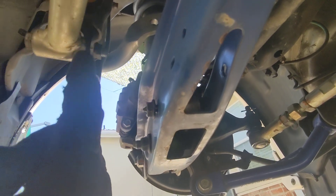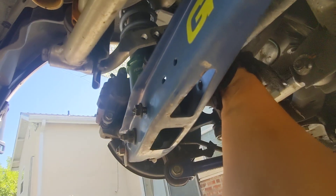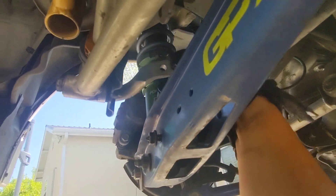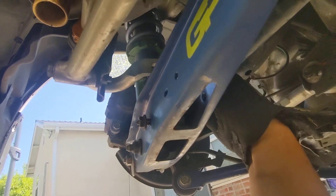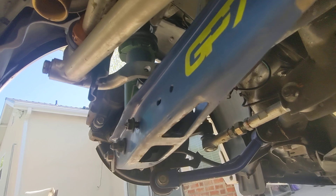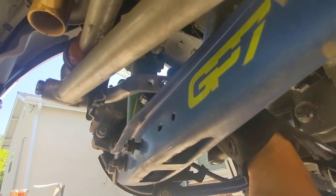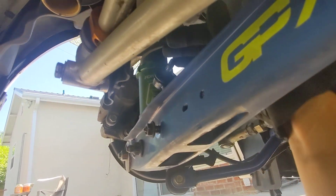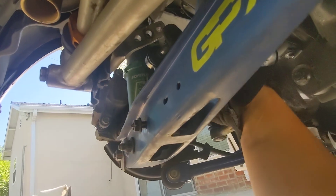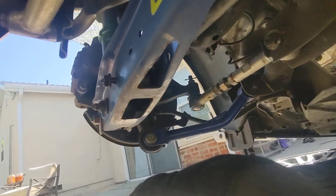I spaced it off just a hair and this is structurally still good and solid, but it allows the sway bar to move freely. All your suspension components should move freely — if you have to use a whole arm to push it up, it's binding, and when you get binding your car jacks up on corners and it's not smooth. Aim for that: I can move this up with one finger and pull it down with one finger. Same thing with end links — you don't want any of that stuff to bind. Right now I've just pulled off the sway bar end links so that I can get maximum droop. Let's continue.